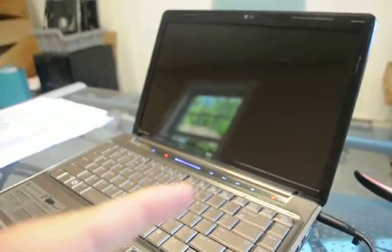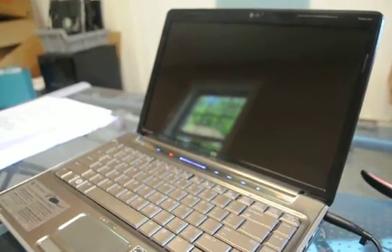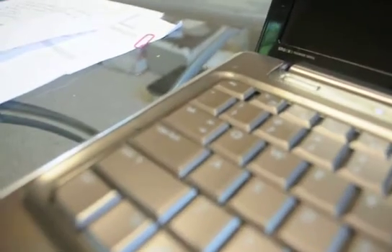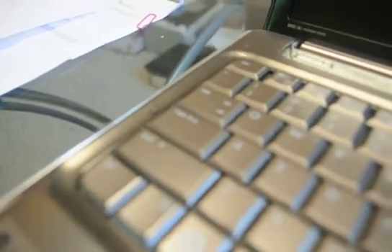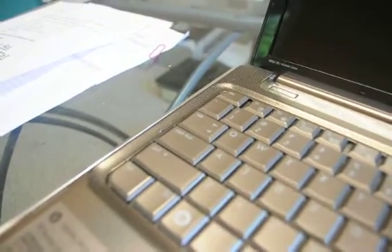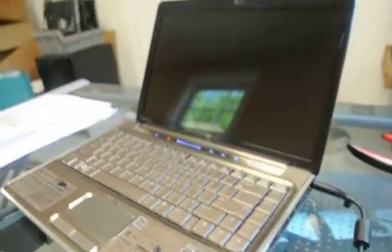So we have this one start up and it shows the lights come on. Then the system will actually go to high fans and then will display by the caps lock key a blinking light. Now that blinking light tells us that there is an actual motherboard issue — whether that's linked to the RAM or to an actual chipset failure.